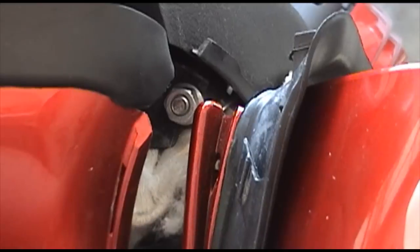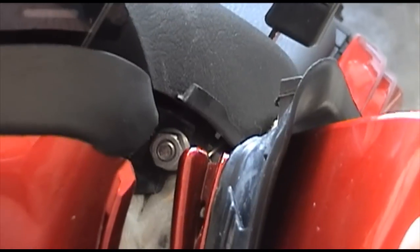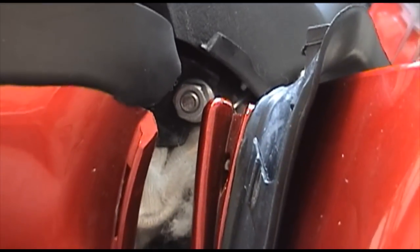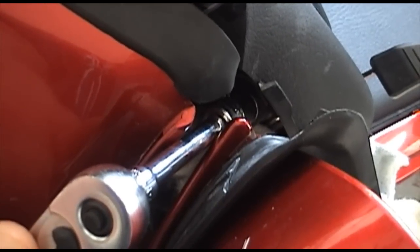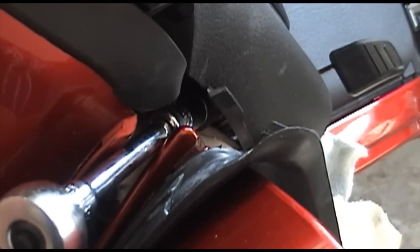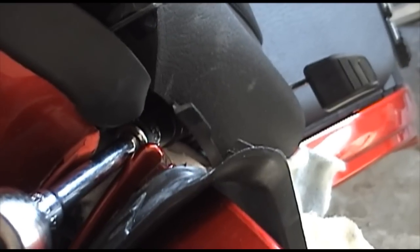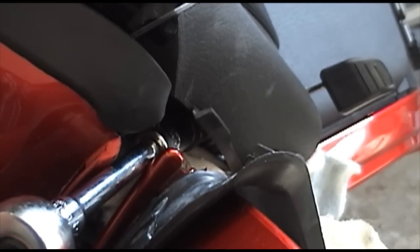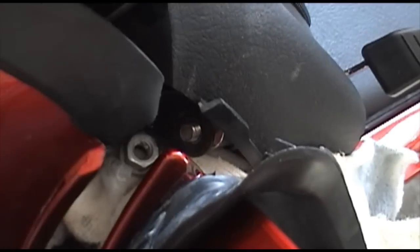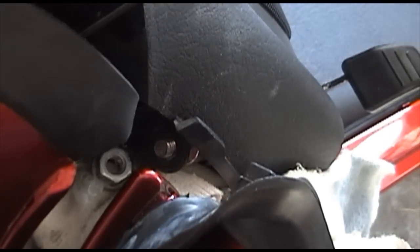For added safety, you can also use a magnetic pickup tool just to keep it close for when it does fall into the rag. I'm going to do this daringly without the magnetic backup. I found it easier if I use a 10mm socket with an extension. That way the socket can get down on the bolt and the extension goes through this narrow gap between the front windshield cover and the side view mirror. And of course, that's exactly where the nut fell as I unscrewed it and removed the socket.